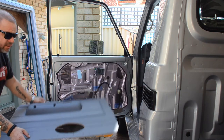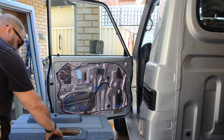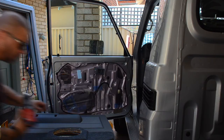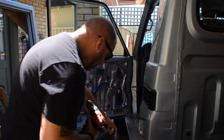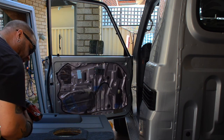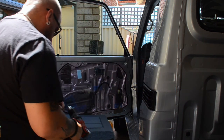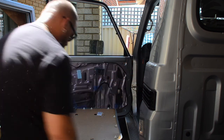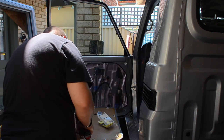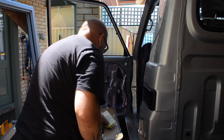So that's now got the hole cut in it. What I'll do now is refit the pod. Once I've refitted the pod I can then mark the hole in the door, just making sure I've got a consistent, equally aligned line all the way around. I'll put a couple of screws in to hold it, then flip it over and put the screws in all the way around. It's actually quite a quick job to do - it's not rocket science, it's just having the confidence to tackle it.